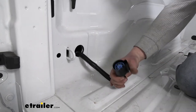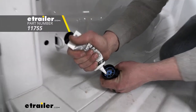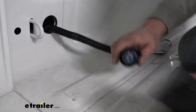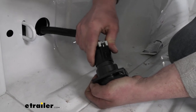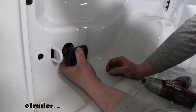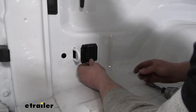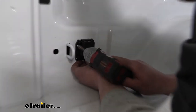Once you have about a foot of wire left to work with, before we plug it into our connector, I do suggest using some dielectric grease on the terminals — it's just going to help protect against corrosion. You can get some of this right here at E-Trailer. Give it a good coating, then take our connector plug, marry the two together, and push down on the keeper. It's almost like a lock so you can't pull it apart. When it's connected, push it flat against the truck bed and make sure it's nice and level.